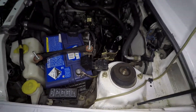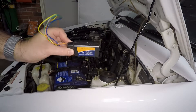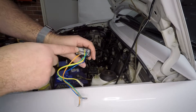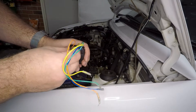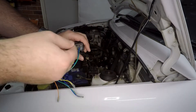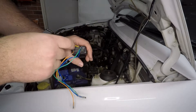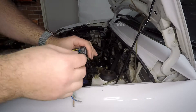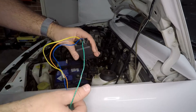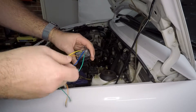I've put together a cheap little rig using a standard eBay OBD2 connector. The pins inside these connectors match up to whatever protocol your car is using. The common ones are the orange wire for constant 12 volts and the yellow wire for constant ground. All other pins depend on which protocol your car uses — Ford and Mazda vehicles from the 90s largely use the J1850 standard, which corresponds to the two data pins I've connected here.